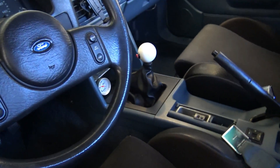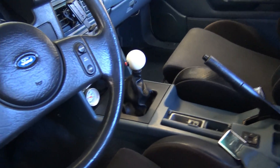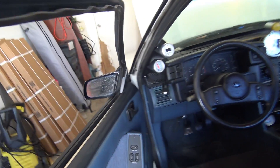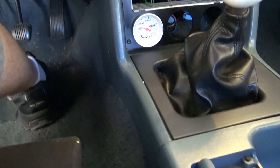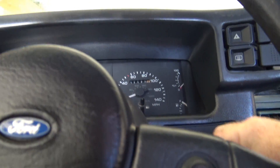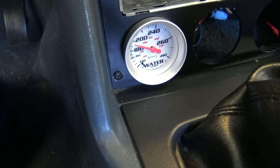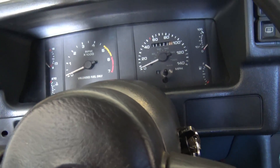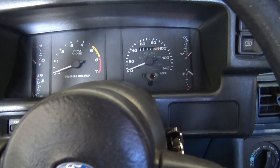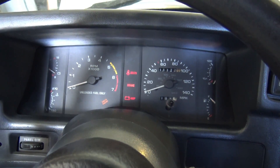All right, we're inside the car. Make sure you have your parking brake on — I've always pulled my codes in neutral. Make sure your car is up to temp before trying to pull codes, because it will throw code 21. That's the coolant sensor out of range — it's only because your car's not warmed up.